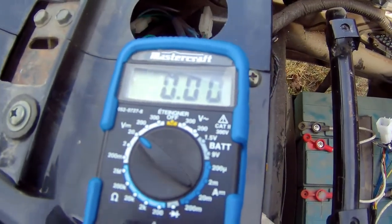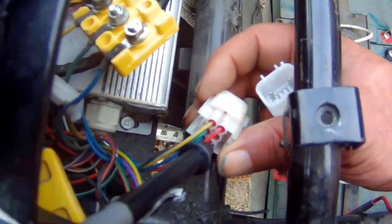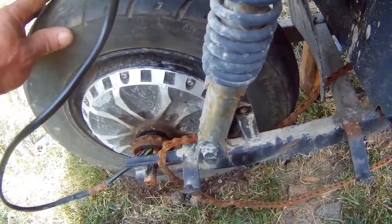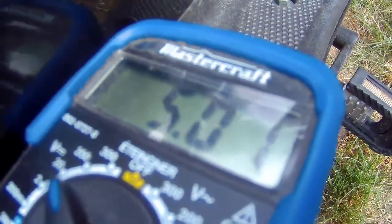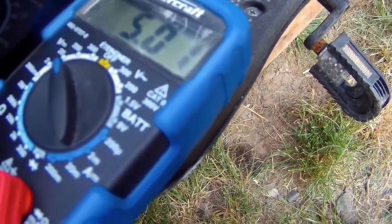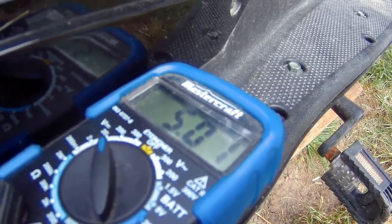The next thing I need to do is plug the motor hall sensors into this plug right here. What I'm getting is 5.1 volts out of every hall sensor. What's supposed to happen when I turn the wheel is this should go to 5 volts and back to zero. I'm turning the wheel right now and it won't change from 5. That's the yellow. I'm getting exactly the same thing out of the green — turning the wheel forward or backwards, I'm still not getting any change. So I think all three of my hall sensors are, let's say, done.